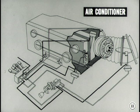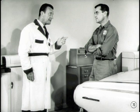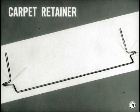There's one Dodge and Plymouth heater we've been forgetting about — the heater that's a part of the air conditioning unit for those cars. Glad you brought that up, Paul. Many of the points we've mentioned for the standard heaters also pertain to the air conditioning units — for example, being sure the owner knows how to operate his equipment properly, plus looking for cold air leaks and checking the condition of the entire vacuum actuating system. Current Dodge and Plymouth air conditioning units have a wire carpet retainer to prevent the front edge of the carpet from curling up and blocking off the warm air outlets. It's a good idea to install this retainer on 62 units too.